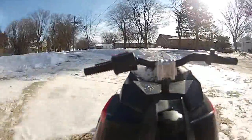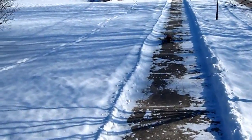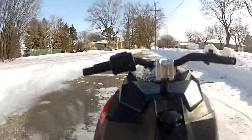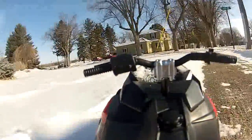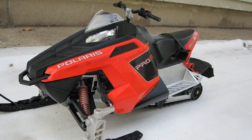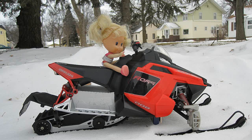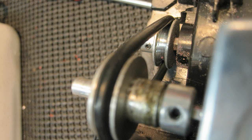What I've learned from this whole modifying ordeal is that even if you had a 500 horsepower engine in your car, you'd still have to start out slow or the wheels would spin — just like driving in snow and ice in real life. In the case of this snowmobile, too much acceleration makes the rubber ground belt slip on its teeth, and it can only accelerate so fast no matter what size your motor — not counting that slow stock setup. I abandoned the brushless motor ideas; they didn't work as well in this case. The pulsing when it did start destroyed the transmission — it didn't run anywhere near as smooth as the brushed motor. Also, the faster you go, the faster it falls over.